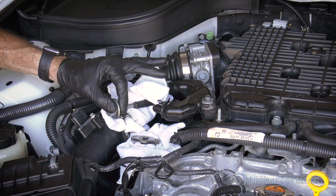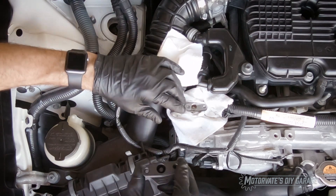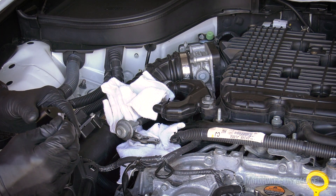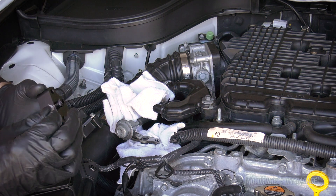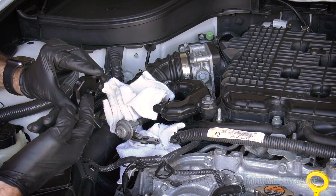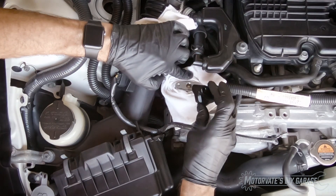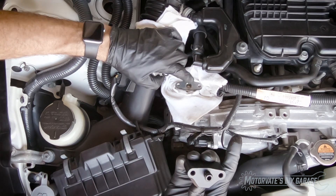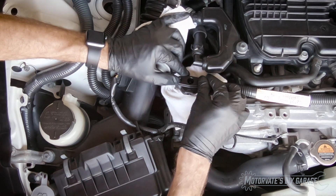This has been disconnected. Now we're going to connect our fuel tap right there. Before we connect it, we need to take some of this grease and put it on the O-ring. This prevents the O-ring from possibly getting torn. Make sure this area is totally clear — we don't want to capture our rag between our fuel tap and our fuel injector rail.